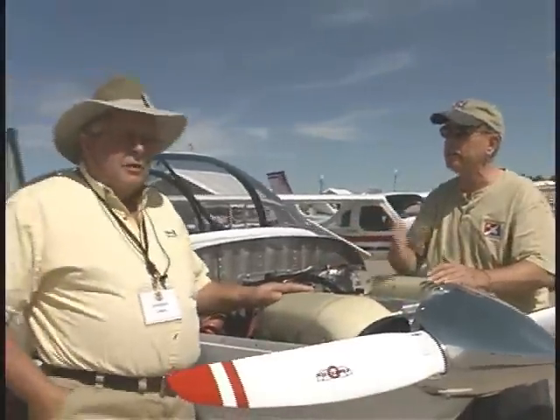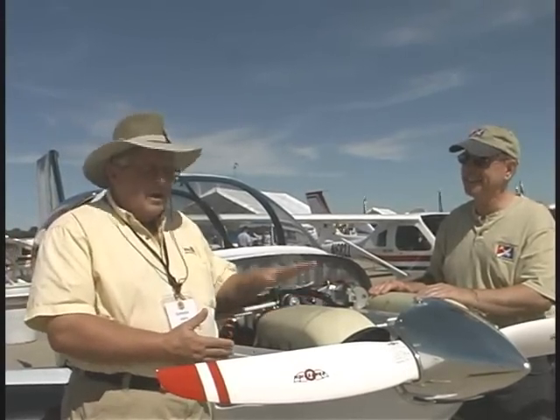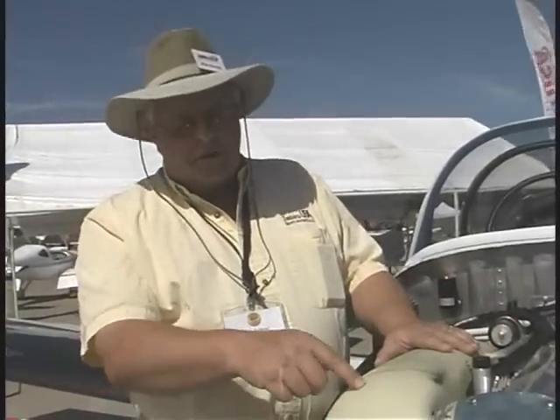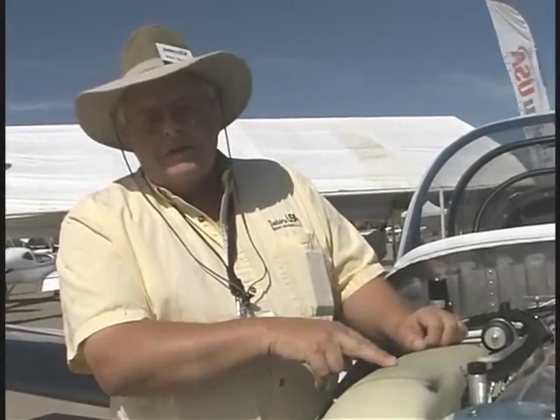Every airplane is a little bit different in how the airflow goes through the cowl. Like any air-cooled engine, you need high pressure above the cylinders and low pressure below so air will flow through. To balance the flow, these deflectors hang about a half inch from the top of this plenum. We start out with them a bit long, fly, and if the front cylinder is cool but the ones behind need to cool down, we shave a little off the front deflector. If the back cylinder still needs cooling, we shave the center deflector — that raises the center temperature and lowers the rear temperature. After four or five adjustments, you can balance temperatures front to rear quite nicely.